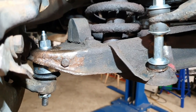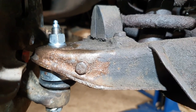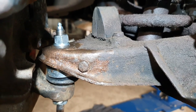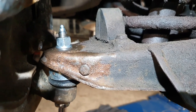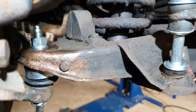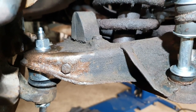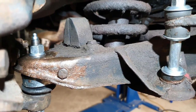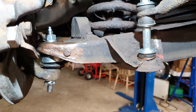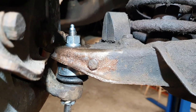I just wanted to mention that if you cleaned it down to bare metal like I did, don't forget to apply some grease or some anti-corrosive product on there so it stops it from corroding. I will be doing under-sealing as well - this is just for now. I will be applying a proper under-seal product on there to stop corrosion and doing the rest of the car as well. But I just wanted to let you know in case you're just doing that job - just put a little bit on there, it does help.